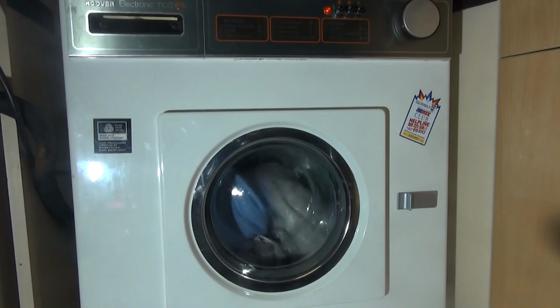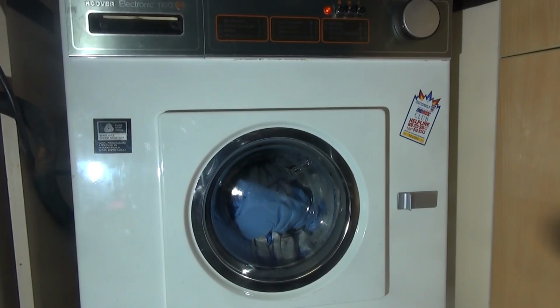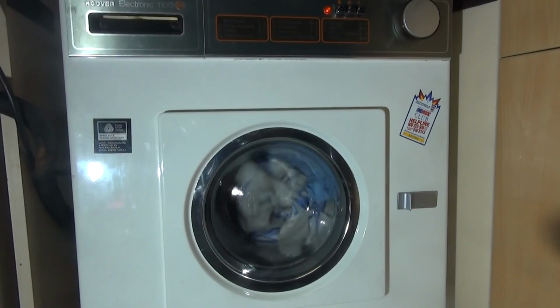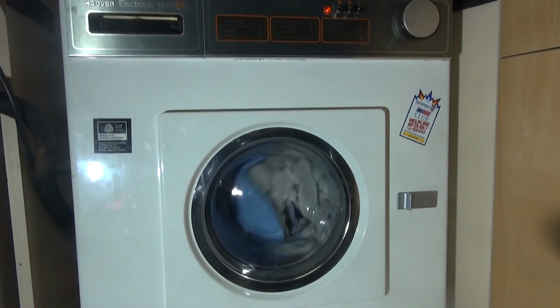That's the one that shuts off the pump before it goes into spin, isn't it? That Millennium you've got, it shuts the pump off before it goes into spin. Yeah, it does actually. That's because Elliot's got the Amiga version of it, washer dryer, and it does that, it shuts the pump off, distributes, and then it cuts in as it ramps up.